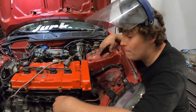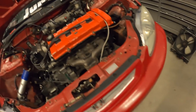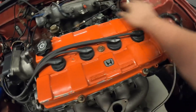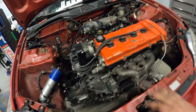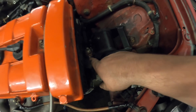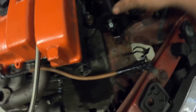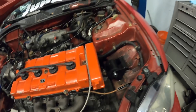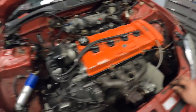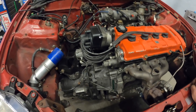The engine is finally in the car at 4 a.m. And these mounts - this thing is solid, it's gonna be a straight shatterbox. There is no give to this engine whatsoever. Every single mount in this car is 100% modified. On this one we could only get one bolt to work no matter how hard we tried - we had to cut the ear off because the mount was too big and bulky and kept hitting. Just don't get these mounts. It took us three hours to get this engine in the car, it was honestly chaos with a lot of cutting and drilling.